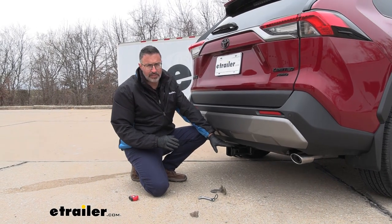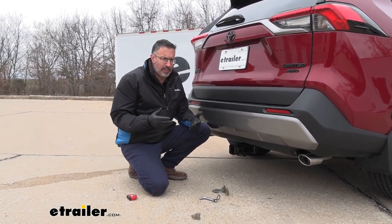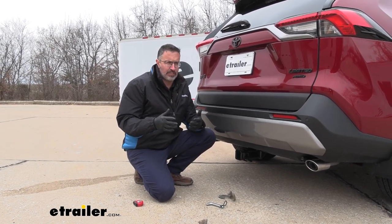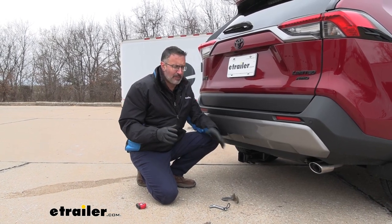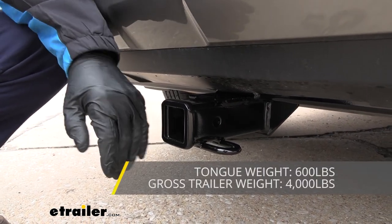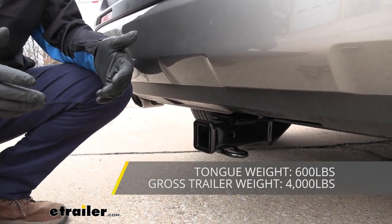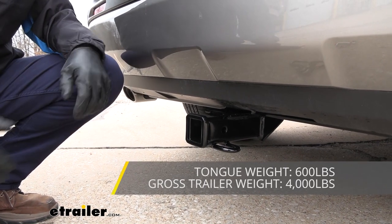Let's talk about some capacities on this hitch. I think this is the best hitch for you if you want to get into either a towing field, or if you're looking at accessories like cargo carriers and bike racks. This is the most popular type and it's going to give you a ton of options. This hitch can take up to 600 pounds of tongue weight rating — that's the force pushing down on the hitch. That's plenty of weight if you're looking at a 2-bike carrier, a 4-bike carrier, or a big cargo rack.